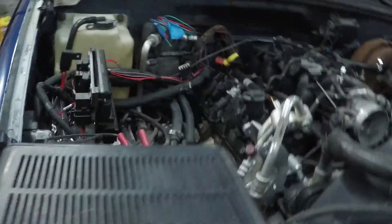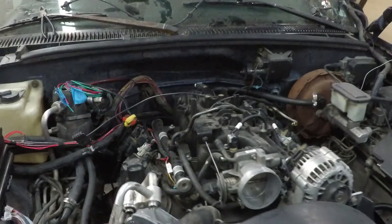After multiple attempts to start and a bunch of smoke issues, not sure where the smoke is coming from yet. Going to check some grounds tonight — battery also seemed weak, so going to let that charge up. Hopefully have a full battery and be ready to go tomorrow. Right towards the end was having some ignition issues, so hopefully nothing's melted too bad. Going to let the battery charge up and check some more wiring, and hopefully have a start for you next time.